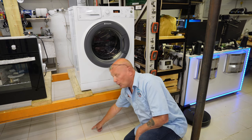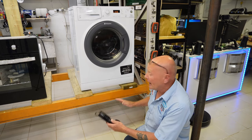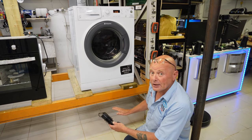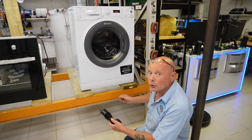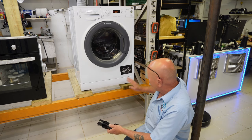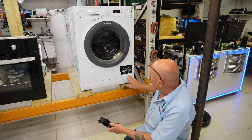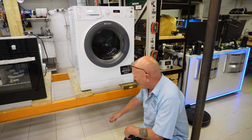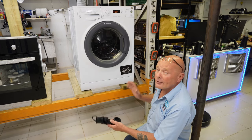The soapbox itself may be damaged or leaking, or it could be this hose. As you can see on the floor here on the bottom left we've now got a drip. If you've got a drip at home you may not be able to see things like this easily, so I suggest you slide a piece of newspaper under the machine to identify where the water leakage is coming from. If it's from the right hand side it would be the sump hose, pump, or waste hose.